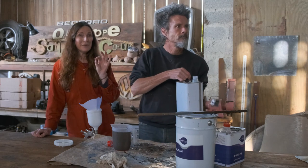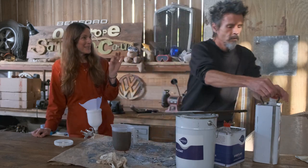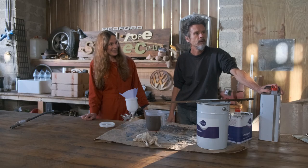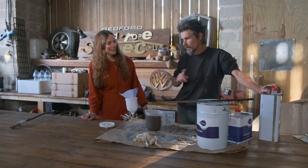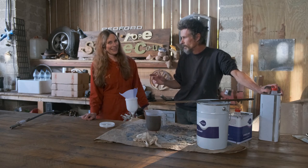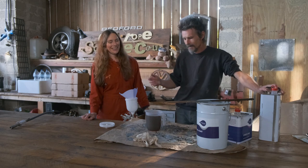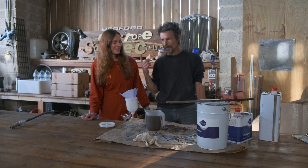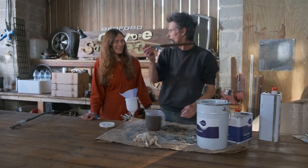We need to wait 10 minutes between each coat. So you've got about 3.5 minutes to do each coat. We do a coat, and we can start the second coat 10 minutes after. So if it takes me 10 minutes to go around the truck, I can continue going without stopping. But if I get around in 7 minutes, I have to wait 3 minutes to start again. So as long as it doesn't take me more than 10 minutes to do a coat, it'll be done in half an hour from now.